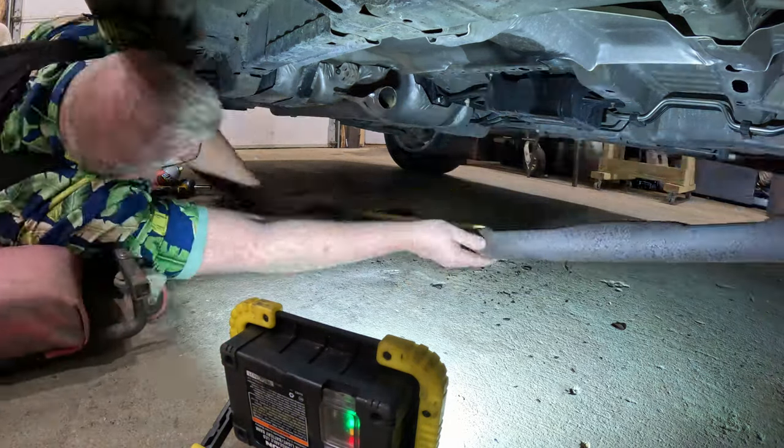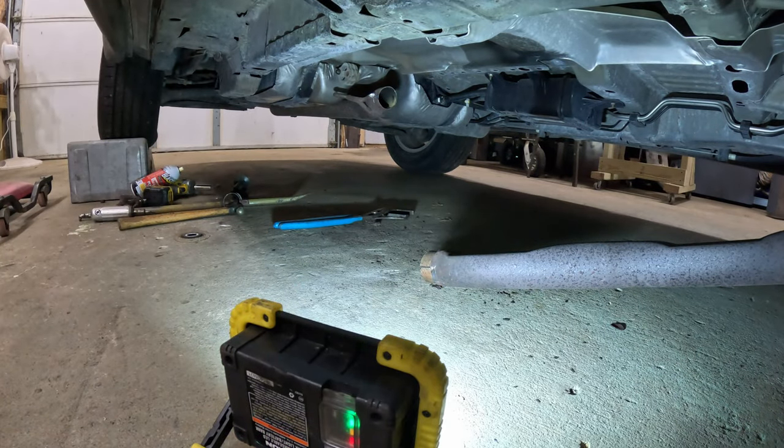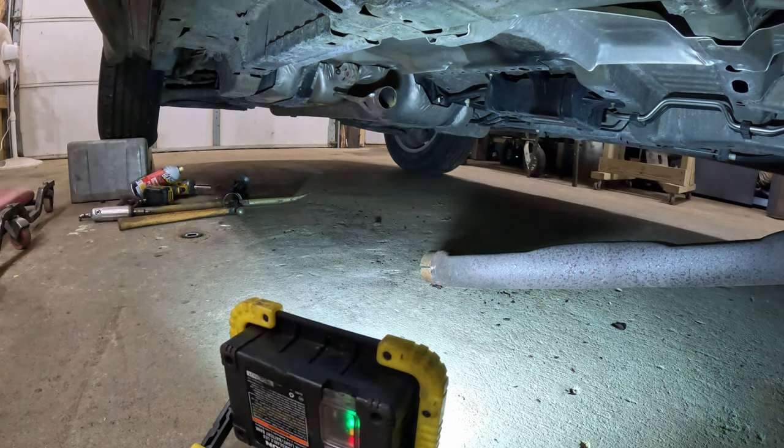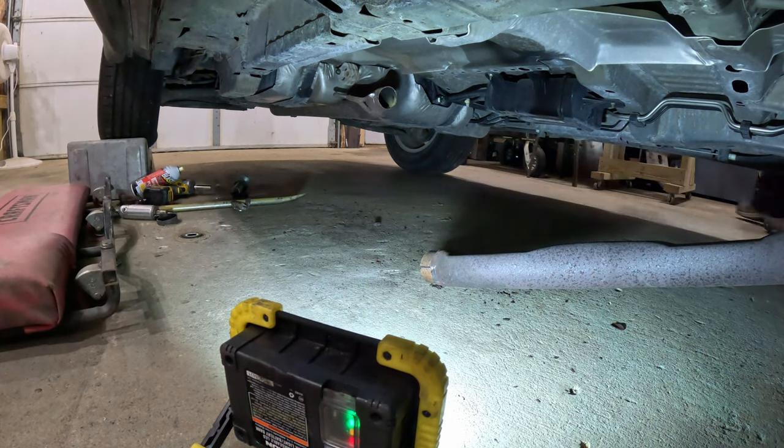The nice thing about these sleeves is they're going to give me a backing for welding. And it's not going to reduce the flow, because actually the muffler itself reduced down even about 2 to 3 times as much thickness as these sleeves. So it wasn't going to inhibit any of the performance as far as how the muffler worked and how the exhaust got out of the car.